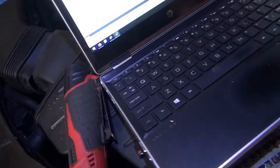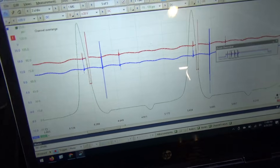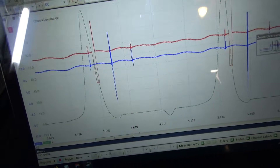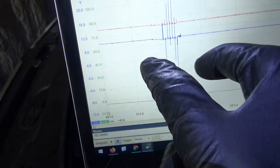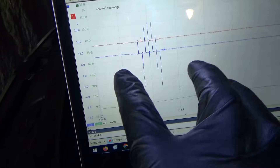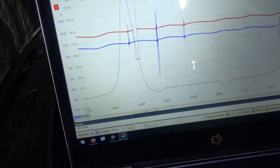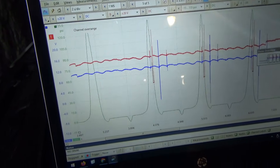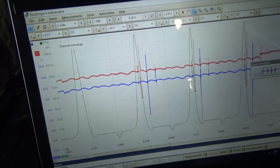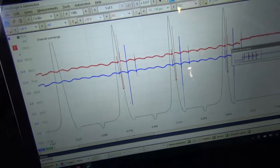Like I thought — no luck. But we do have six little noise packets now. Reconnecting that ground definitely did not change much at all. There's just one event that might be sparking — maybe one out of six cylinders is trying to fire, but this is not good news. The owner said he's going to get it fixed and eat the cost, but if I was the customer and I had proof that the dealer caused the damage, I would not let this go easily. That's it for tonight — I hope you enjoyed that diagnosis. Thanks to Keith for pointing us in the right direction. Fried engine computer. Thanks for watching, we'll see you next time.